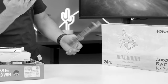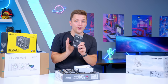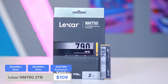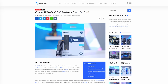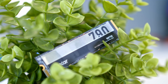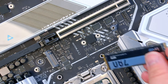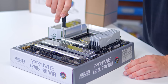SSD is going to be the Lexar NM790 — a 2TB Gen 4 NVMe. You could go Gen 5; I recently looked at the new XPG Gen 5 drive and also the Crucial T700. They're good, but they're not ready yet — they run so hot and need fans on some of them as well as large heatsinks. Gen 4 is going to be perfectly fine, and we don't need the extra speed. As the drives come down in price and become more affordable, they will be considered for builds like these, but currently too expensive, too hot, and a bit of a faff.